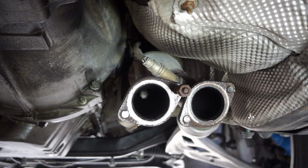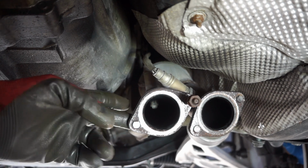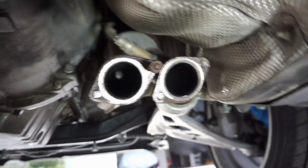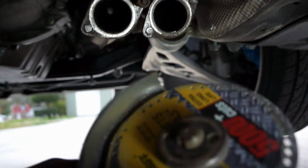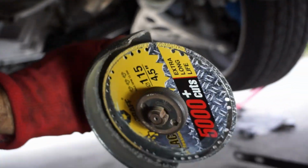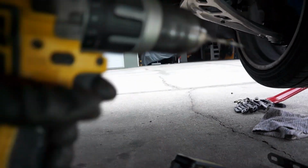As I was saying before, three out of the four studs broke off on my exhaust here. This is the downpipe that comes off the engine, and so what I did was I cut them off using my angle grinder here from DeWalt with a metal blade on it. And now what I'm going to do is I'm going to drill out